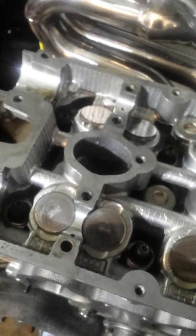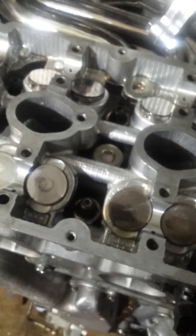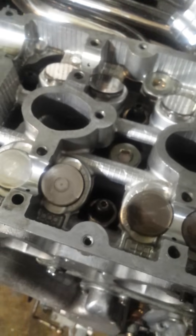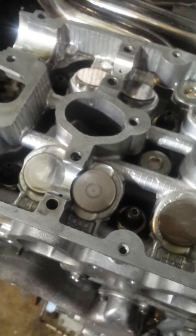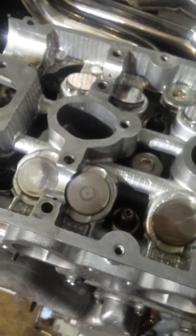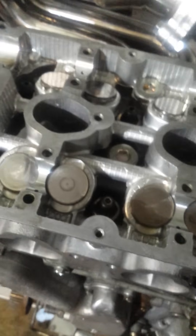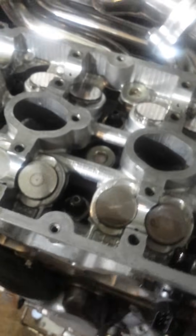Until you break it, you'll have no compression or less compression. And if you have too much gap, that's just extra slap wear from the cam lobe onto the surface of these. So I figured I would show the grinding of one. The valve lash adjustment is typically done by replacing these cups with other cups. So I got an engine — well, just a blown up engine.